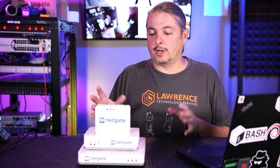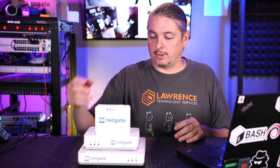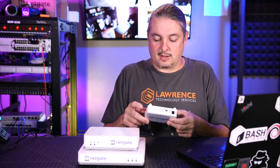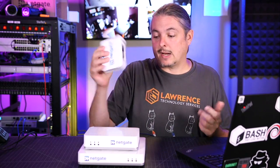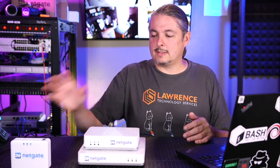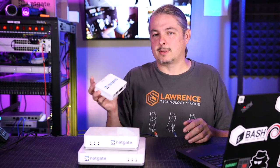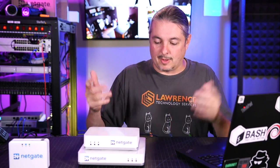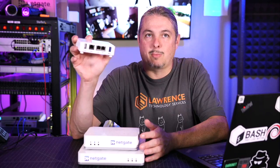So let's start here looking at the lineup of ARM-available devices from NetGate in 2020. NetGate has this SG1100 — this is the $179 box. I've used quite a few of these. We recommend it to a lot of especially home users, provided you don't have an internet connection that exceeds about 400 megs. These will route perfectly fine but start to choke at higher speeds. There's some limitations to a $179 device. It's very reliable, but that's a limitation.